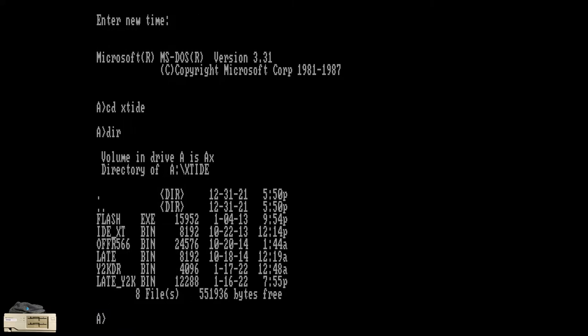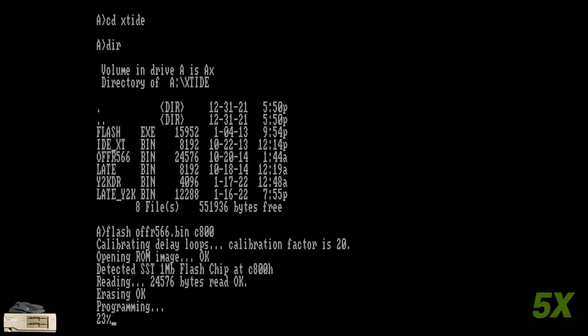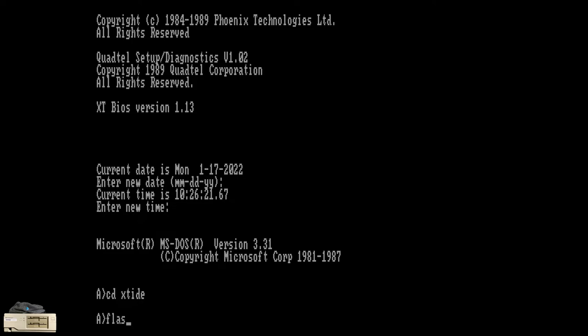There is a special reason why this image is padded with FF bytes and not 00 bytes. This is because memory chips, including ROMs, pull the bus low to indicate a logic zero. By padding the first 16K of the BIOS image with FF, the flash chip won't try to pull the bus low while the other ROM chip is being read. However, the padded ROM image had no effect on this computer. Given that D800 didn't work, I was not surprised.